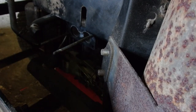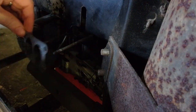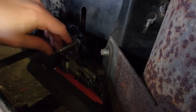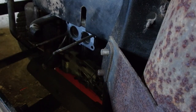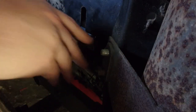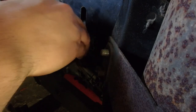When you get ready to go back together, keep in mind you've got a plastic spacer between the engine and the carburetor right here, and there's a gasket behind it. Our new gasket is not cut out right there but that's fine - it's not going to hurt anything. Slip the carburetor on - this side goes up against the engine. Before I get it all the way up in there, I'm gonna go ahead and attach my fuel line because that's kind of a stretch and it's hard to get the clamp on it.